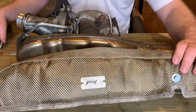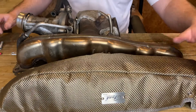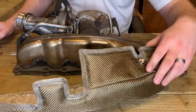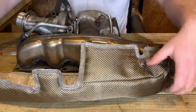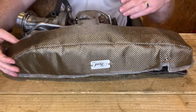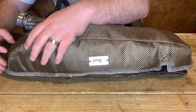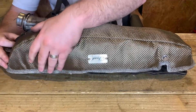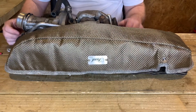Okay, that's pretty easy. Yours may or may not have another anchor point here, but the process repeats the same on both sides. As always, we're going to start with the hardest to reach anchor point first — which is on this side here — so we're going to do that one by hand while it's free of the vehicle. Slide it over the manifold portion making sure it fits at the anchor point as we did before. Slide that into place and you'll notice again there's a coolant line — just manipulate it into place so it sits nicely.